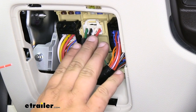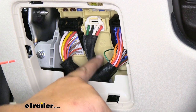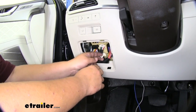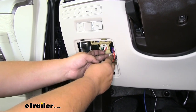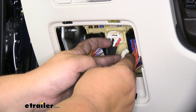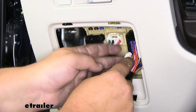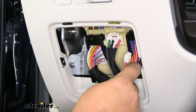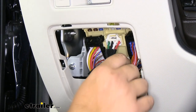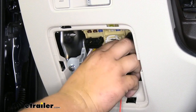The red wire is going to be a little bit different — it's going to get tied into the brake light switch on our vehicle. It is really hard to work with a brake light switch on the brake pedal, but if you track that wire back into this fuse cover, our black and green wire is right here. So we're going to add our red wire to the black and green wire using a quick splice connector. We are going to add our green and black wire to the inside of our splice connector to get started — just slide that over like so and make sure it's totally seated. Then we can grab our red wire, add it to this side of our connector, and then grab needle nose pliers and crimp down on this tab. You can grab those needle nose pliers and make sure our connection is complete, give a little tug to make sure it's not going anywhere. It's good, so we can close our cover.